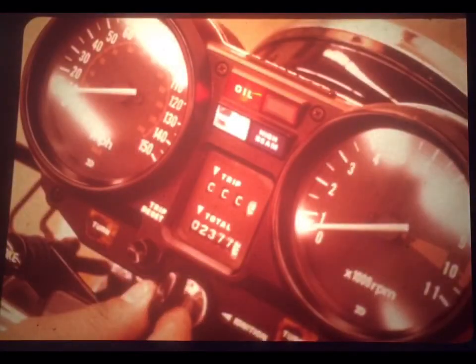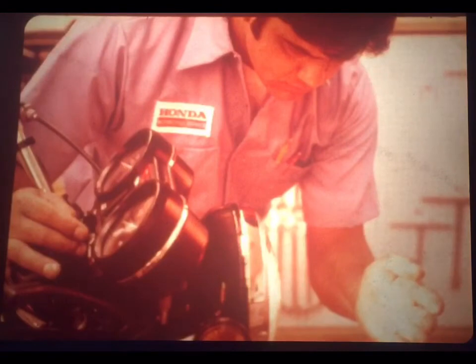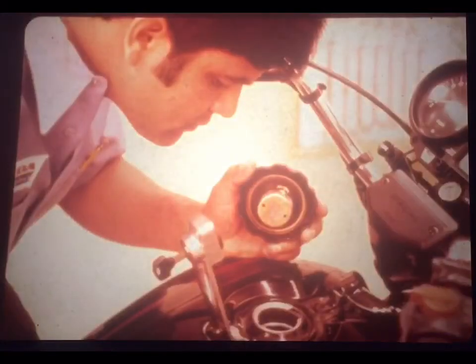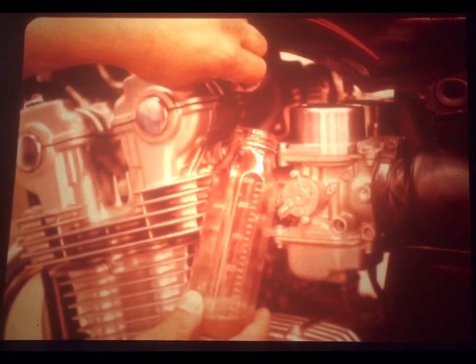And so Joe begins a check of the obvious, the common sense things he checks every time a bike won't start. Let's see, the ignition switch is on, so is the engine stop switch. Headlight's pretty bright, so the battery should be okay. Well, at least we got some current to crank this baby and run the TPI system. Okay, now let's see. There's fuel in the tank. The fuel valve is on, so fuel should flow through it. Sure enough, it does. It just takes a second to pull the line and check. Man, that one bike with a clogged petcock almost drove me crazy.